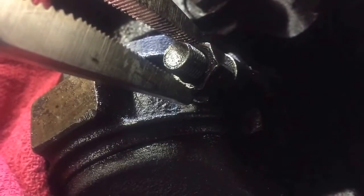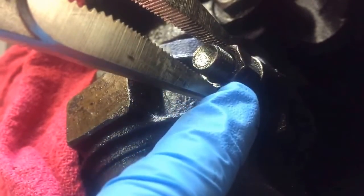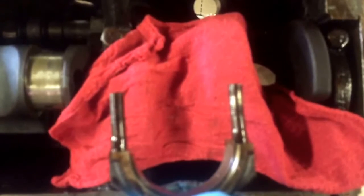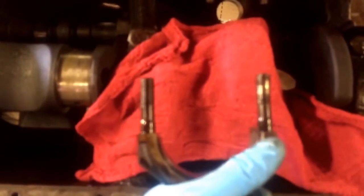What you're looking at is the number five piston — this is one of the cap bolts, and this nut here is stuck on there. I'm just barely twisting this and it just spins. What happened is when the guy who originally put this engine together, he stripped it — he had to have. I'll put on a pair of vice grips and yank up on it, see if I can get it to jump-start on a thread. If that doesn't work, I'll probably cut it. I ended up cutting the nut off. I'm going to get new pistons anyway — they're not horrible, but I don't like finding easter eggs.